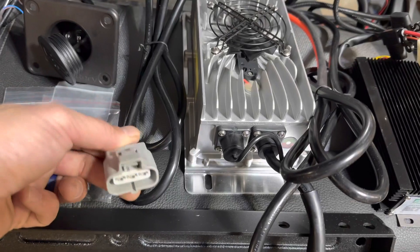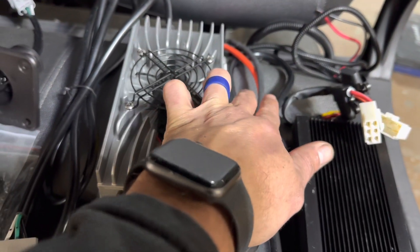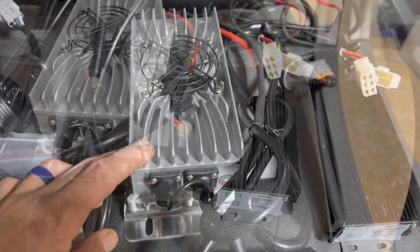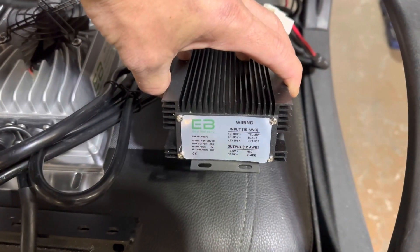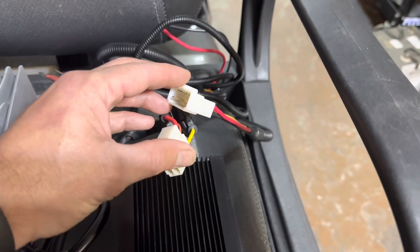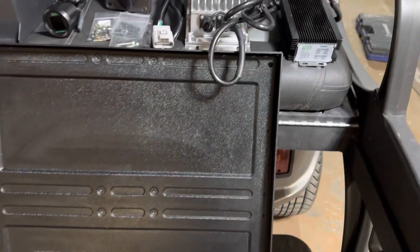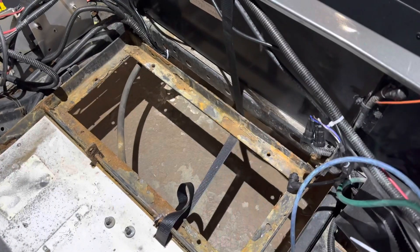This is the side you plug into the charge receptacle and this is the side that goes to the battery — positive and negative. This is a 15-amp charger. Then you have your 12-volt reducer — this is a 30-amp 12-volt reducer, it's really nice and it comes with the wiring harness. We'll show you how to hook that up. And for this customer, the last item is his new battery tray.